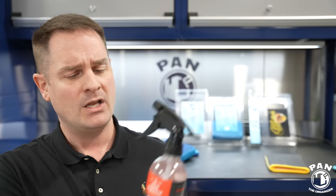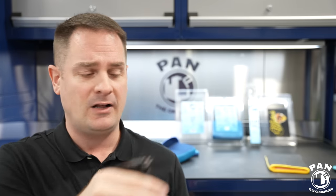If you're working outside, rinse the panel immediately and work panel by panel. In a controlled environment, you can do the entire vehicle without worrying about products drying on the surface. Never let iron removers dry on the surface, and do not use them in direct sunlight — work in the shade on a cool surface. For each panel: one to two sprays directly on the towel, another spray on the panel, put the clay media on the sprayed spot, decontaminate, and move on to the next one. You've combined both steps.